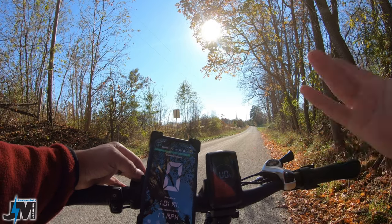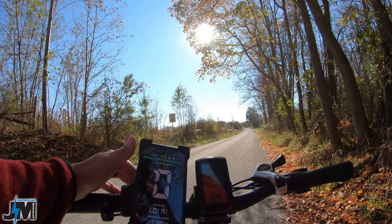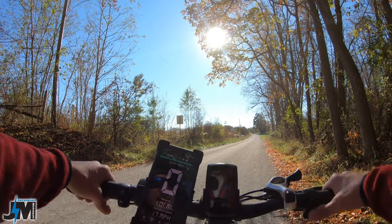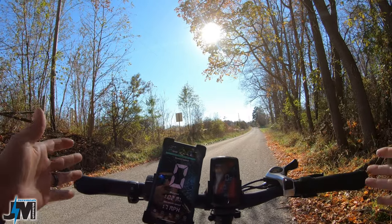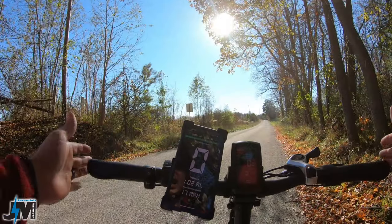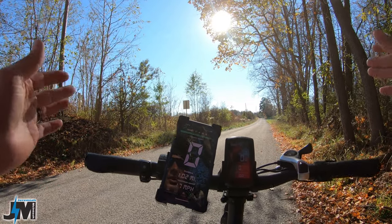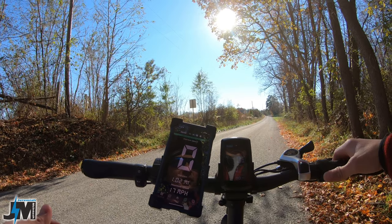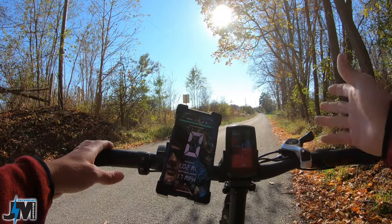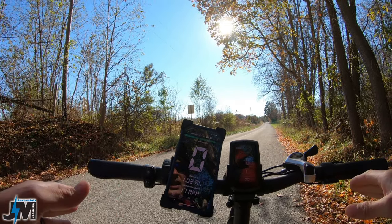I'll probably change that to 0 to 5 later on — that's usually how all my other bikes are. I'm not going to change any of those other settings for now. Usually I have to look at the manual to see what they are. Now, this is where they changed it on all their newer bikes and newer shipments, even on the new Mars and Cityscape shipments. When I did the review on those other two bikes, the throttle only worked in PAS 0. Now the throttle does not work in PAS 0 — you have to be in one of the pedal assist levels, either 1 through 3 or 1 through 9, for the throttle to work.